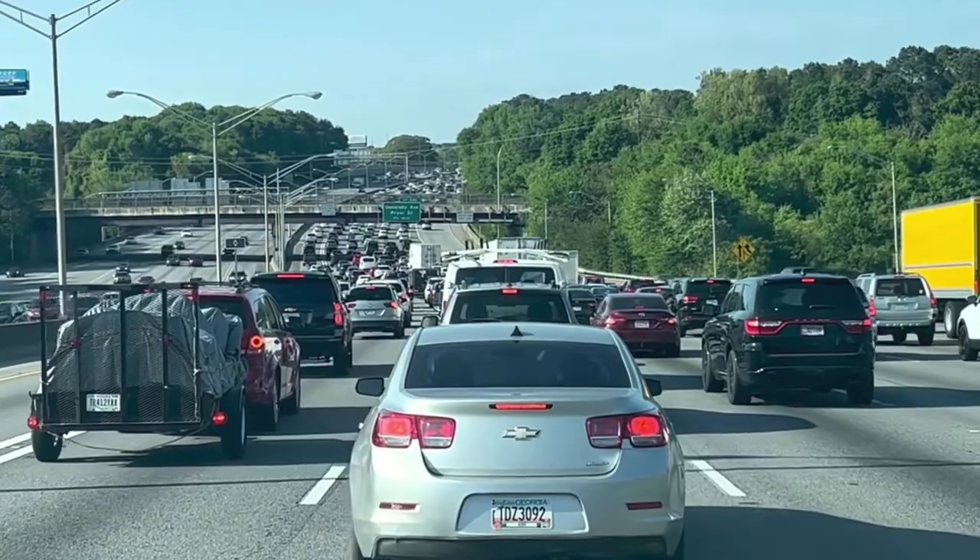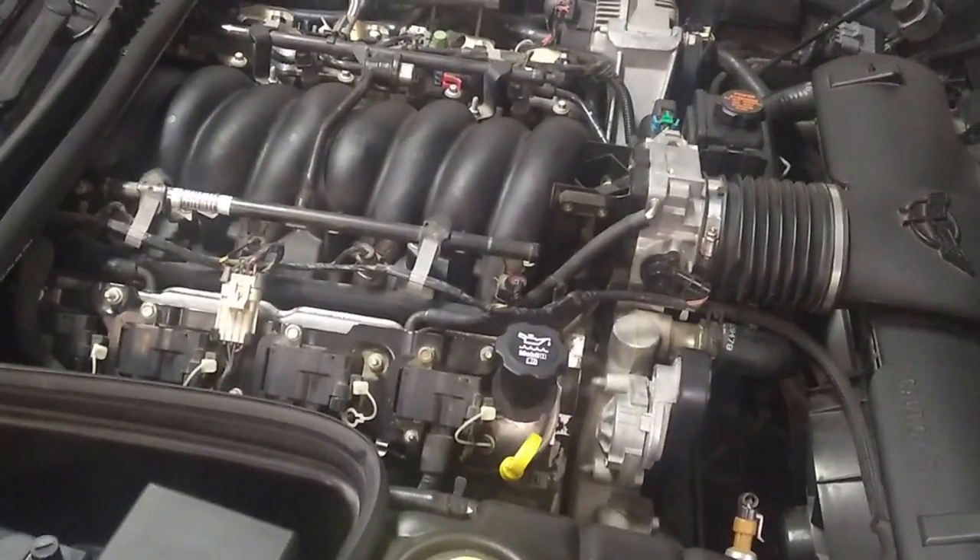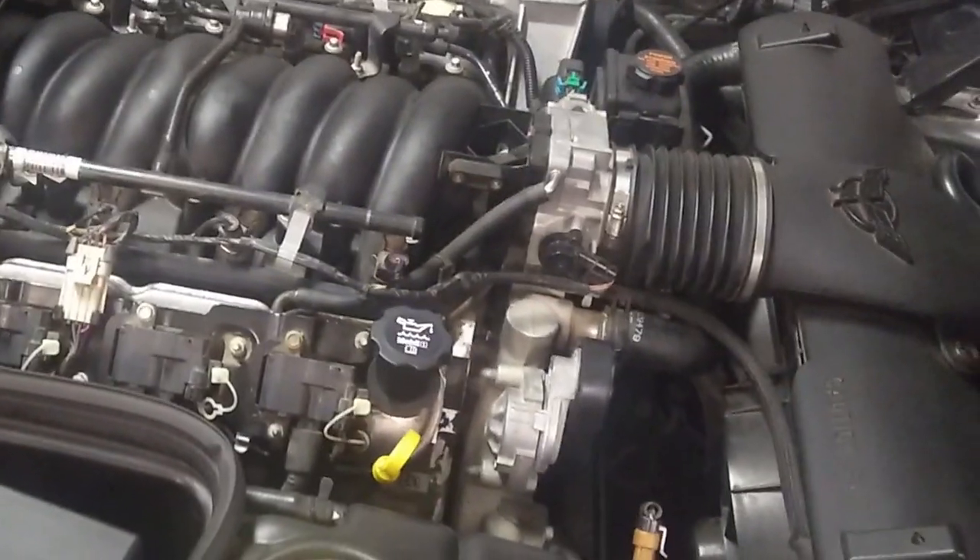In the real world most days you drive your C5 will be warmer than 50 degrees and trips will often be shorter or stop-and-go. Take the same stock C5 on a 95-degree stop-and-go day and your coolant temperatures will hover around 225 to 235 degrees — the temperature where the stage one fan cycles on and off. That's a whopping 30 to 40 degrees above what we determined was likely ideal, and allowing temps to reach 230-235 degrees will heat everything from the intake manifold to the air filter, costing you serious horsepower.